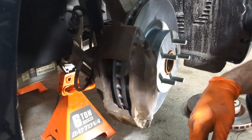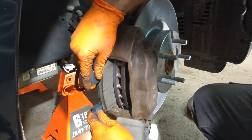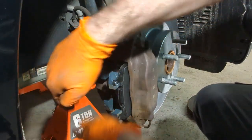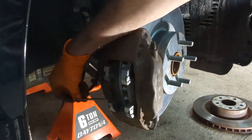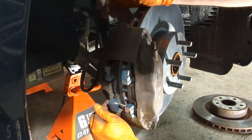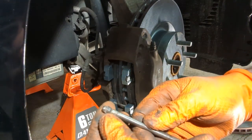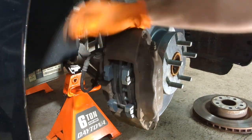Now we need the new brake pads. Slide them in with the friction material facing toward the rotor. With the brake pads slid in, put the bottom or top pin in and press it through. When it's all the way in and aligned, give it a good tap to lock the collar piece in. These have a little snap ring at the back that expands into an indent — that's how they stay in.